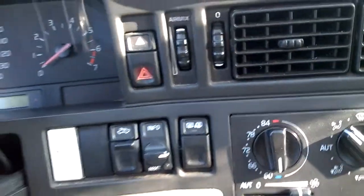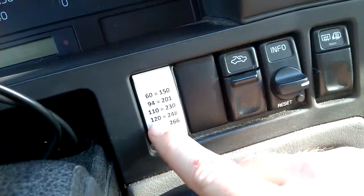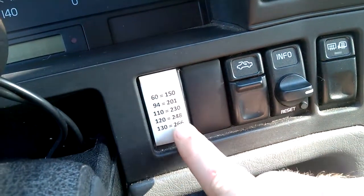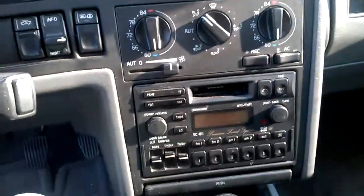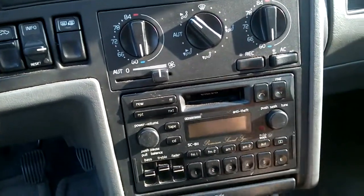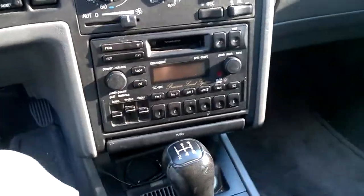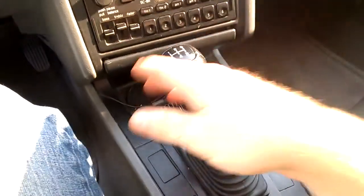There's a little white conversion panel for celsius-to-fahrenheit so I can read the oil temperature without doing the math in my head. All wires are run down through a very accessible panel. I took the factory radio, opened it up, and soldered in a phono plug so you can hook your phone up and listen through Pandora or whatever — through the one working speaker. And there's the Innovate AFR gauge.